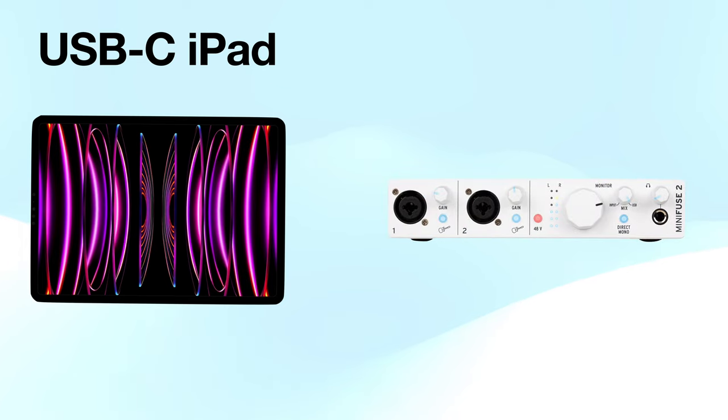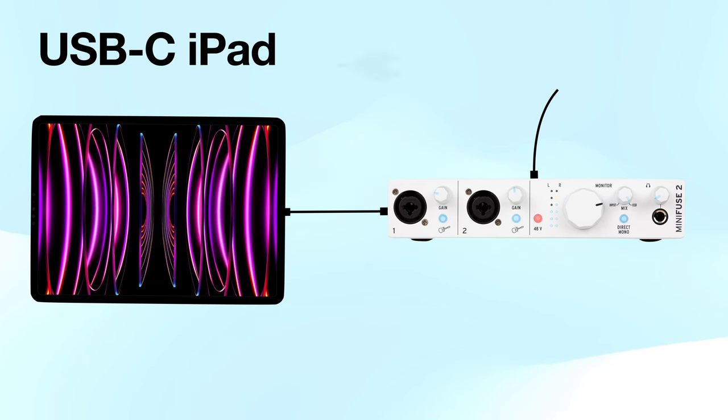Don't forget, this will also work with iPads that have a Lightning connection — you just have to check which iPad it's compatible with, as some of the really old ones won't work. The next diagram is for USB Type-C, covering iPads that have USB Type-C, which pretty much all the new ones now are. Two options: the first is the powered option and the simplest of all — a USB-C cable going into the iPad, and the other end going into your audio interface. The more advanced iPads, like the latest iPad Air and iPad Pros, have enough power to actually power the audio interface, though bear in mind it will drain your iPad a little bit quicker. Alternatively, if that audio interface has its own power supply, you can just plug that into the mains. This is the simplest solution: iPad, USB-C cable, and into the USB-C audio interface.